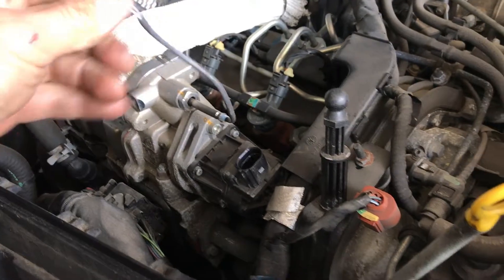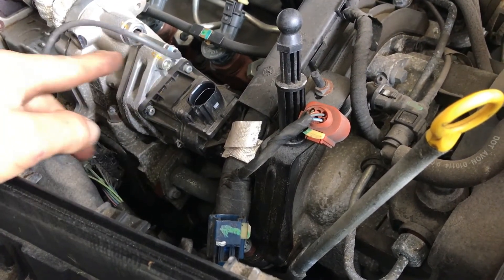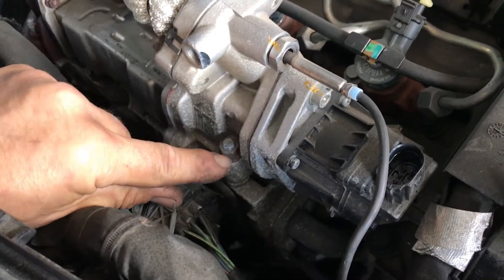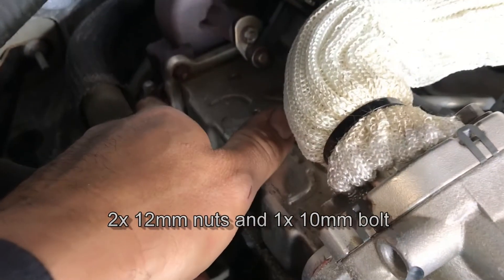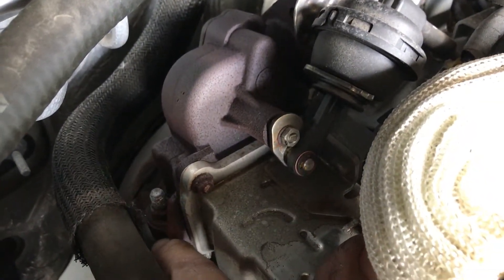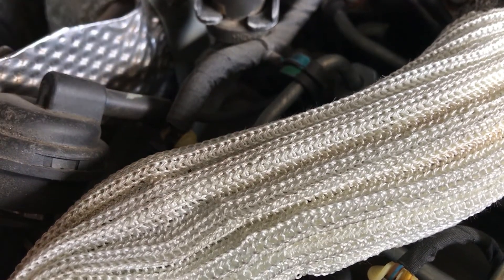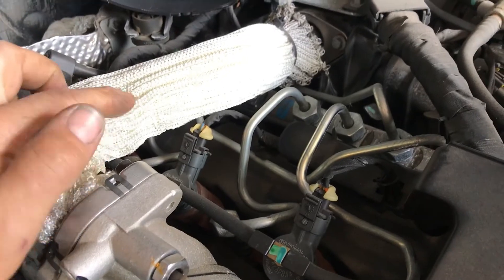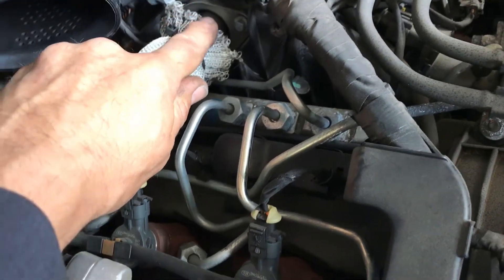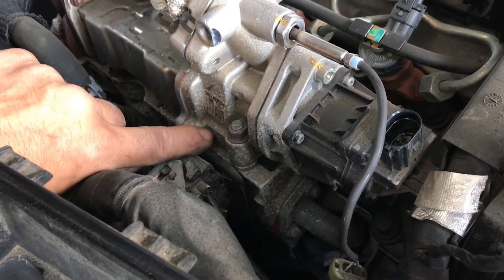We disconnect one connector, then a second connector. The EGR cooler comes together with the valve as one whole assembly. We've got a 12mm bolt here, another one down there, and a third one down here. There's also a little vacuum actuator — you need to unscrew this hose; it's a little hard to come off, but the EGR cooler comes with it, so even if you break it, you'll be fine replacing the whole thing. After you take the pipe off it's going to be nasty, so clean that up, replace all the gaskets, and there are two o-rings on the bottom of the EGR cooler for the coolant that need replacing as well.